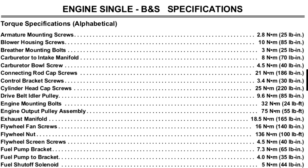I was going to say factory gasket, but from the factory, that valve cover is put on with RTV silicone, and it does work very well. But I thought I would use the gasket since it was supplied, and if it starts leaking, I'll take it out and go the RTV silicone route.